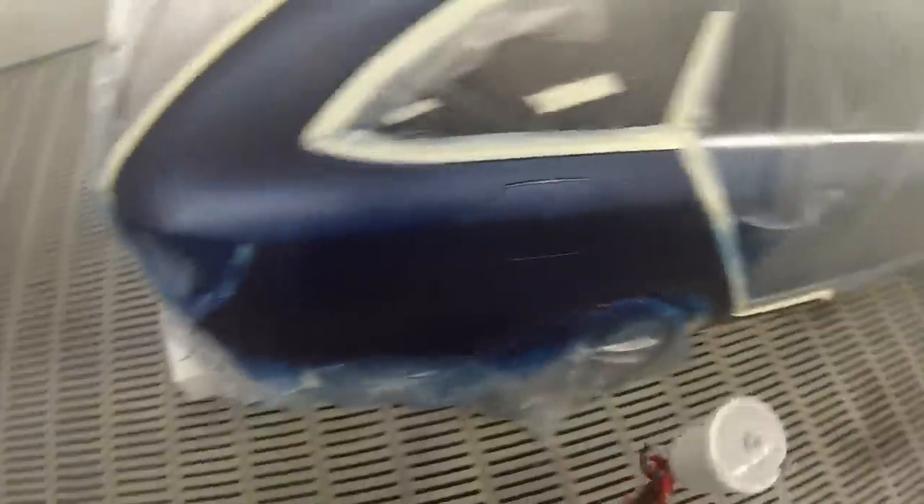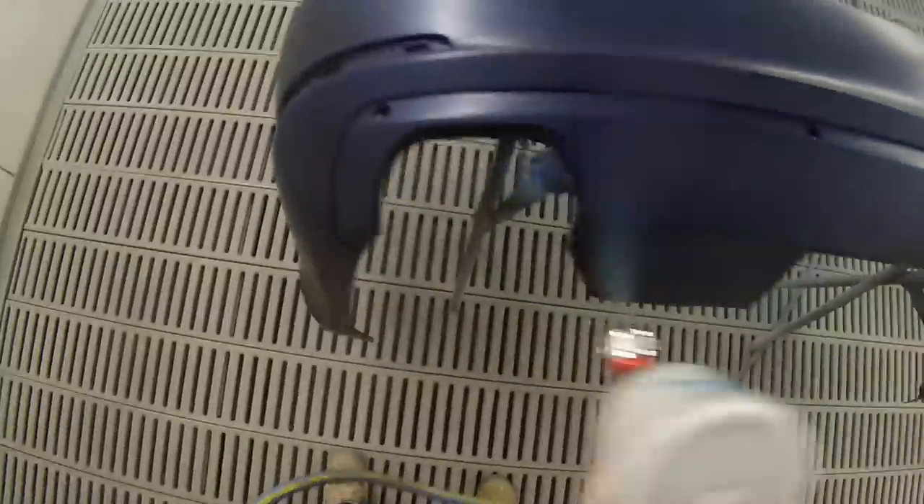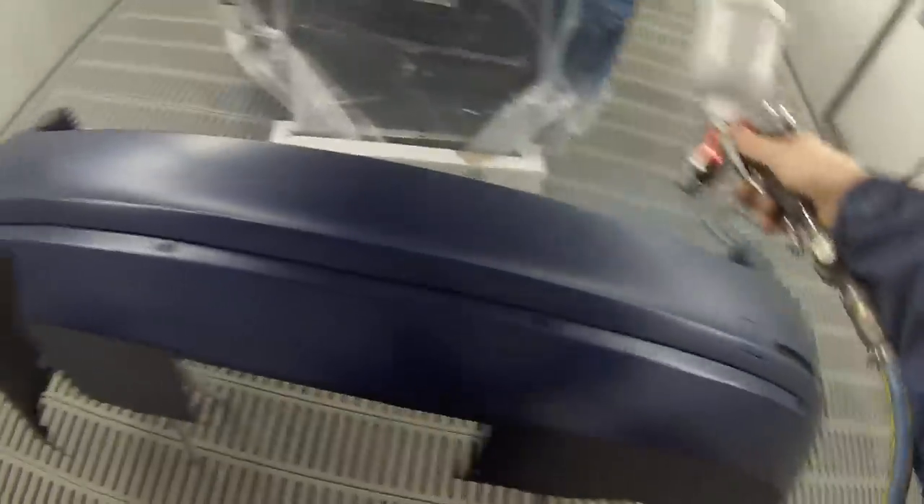So this is our third coat of base coat. I've decided to put an extra one on after this to make sure it's covered because the color didn't cover that well. Usually these kind of blues come a little better, but this color is actually full of pearl — 803 is the number in the Standox. As you can see it's still a little bit transparent there.